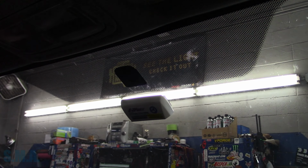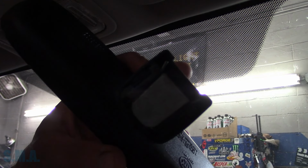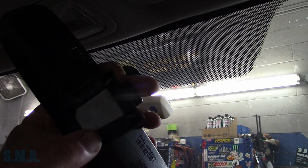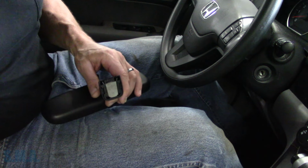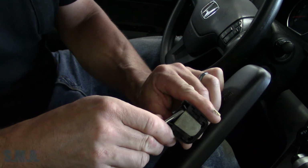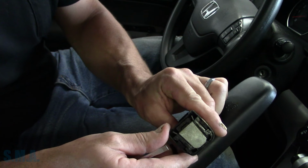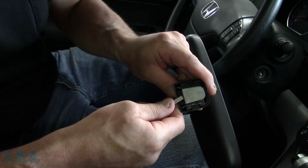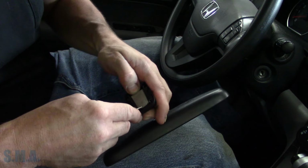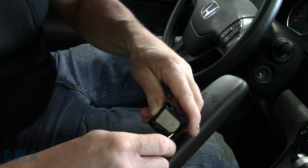Oh, looks shiny. And then the other thing you need to do is the button on the mirror. So that's that little metal button. Well, we've got to pop that button off, and then we also have to clean it. So this particular vehicle is, as you can see here, a Honda. This one has just little dog ear clips on either side that retain it, and then a little push tab right there that you push down on while prying out the button.